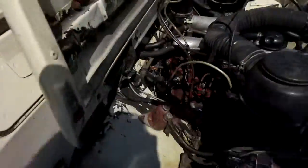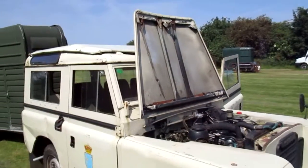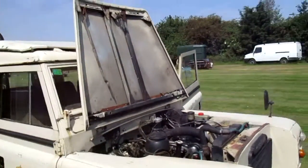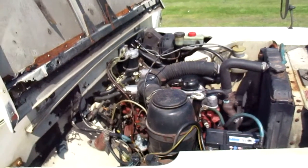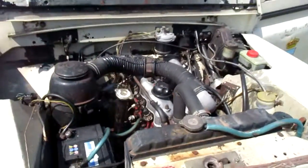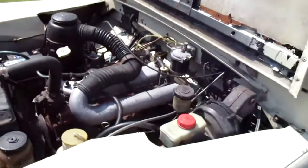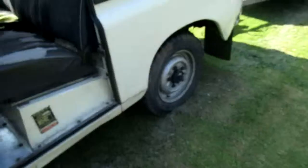We'll open the bonnet — take the pin out so the bonnet goes right back. Not many people know the Land Rover bonnet goes right back, but if you're servicing your vehicle always use a bungee onto the roof for safety, because the pin really hurts when it goes through your head. This is a 2.25 diesel, same as a Land Rover Series 3, but Santana have a better air filter and better fuel pump system — though an ordinary Land Rover fuel pump fits. It has boost brakes; the brakes are Land Rover brakes, not modern, but there's nothing wrong with them.